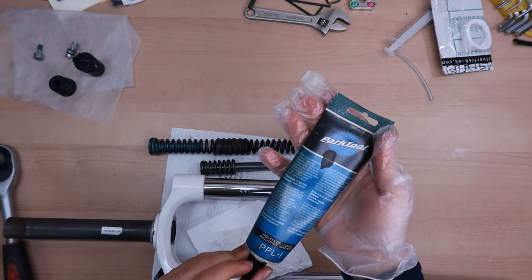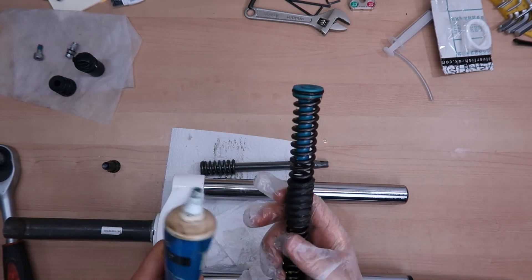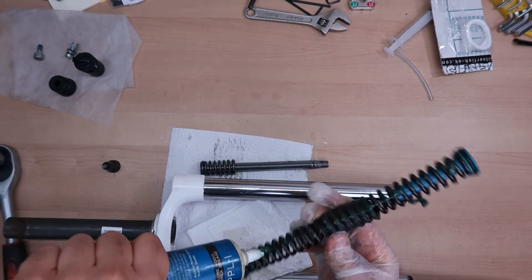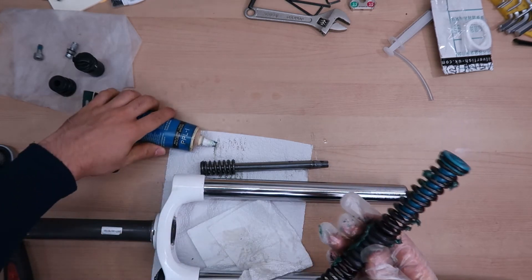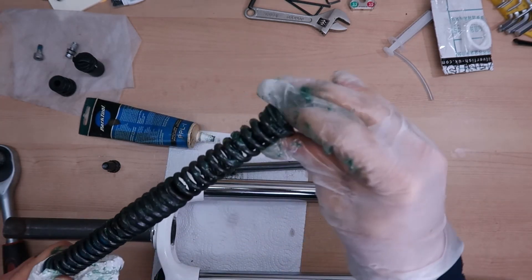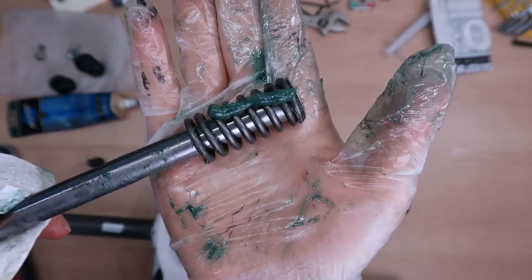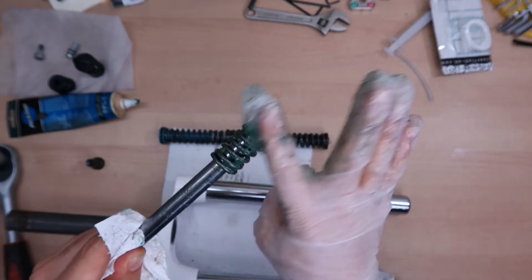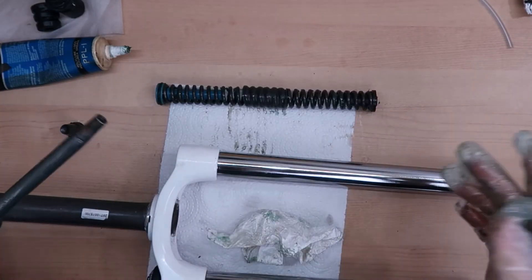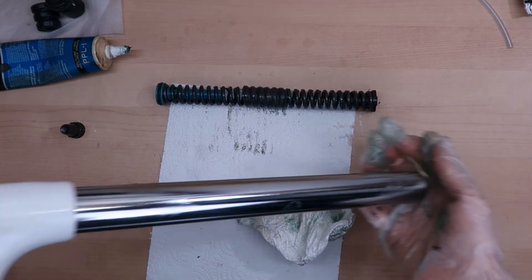I have this Poly Lube, so I'm just gonna put it on the spring so it will allow it to move a bit more smoothly inside the spring chamber. I'm just putting enough to cover the outside — you don't need a lot. Okay this is a bit of a mess, anyway you have to get your hands dirty I guess. That's pretty much all you need for this. I'll do the same for the bottom part — one squeeze of grease and you can just rub it around this spring here and maybe a bit on the shaft. That's it — this is an entry level fork so it doesn't have that many parts, so it's pretty easy to service. That's what makes it a great beginner fork.